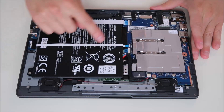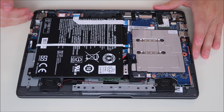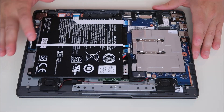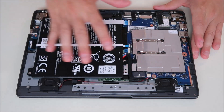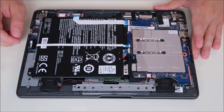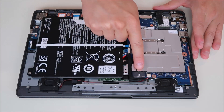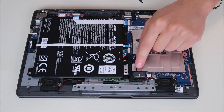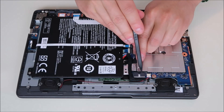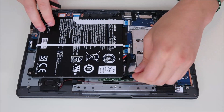So we're inside your computer. Here's your battery, there's your motherboard. Just like we unplugged your power adapter, the next step you take in any computer repair is to unplug your battery from the motherboard. You want as little power running through the computer as possible when you're working on it. So we're going to follow the battery cable up — it plugs right in there. We're going to use a plastic pry tool. There's a little fitting right in the center that lets you put this in and press off on it, so that comes unplugged just like that.